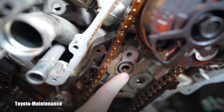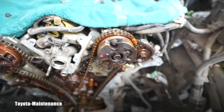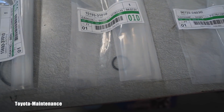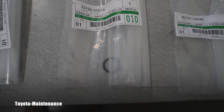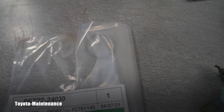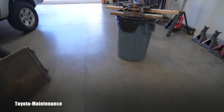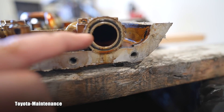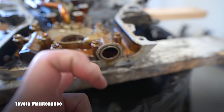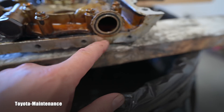Here is a very small o-ring — don't forget to replace this one. In the set I presented you, that's the small one. The bottom one is also for oil — it's larger and thinner. Here is the bottom one; don't ever forget about replacing it. This one is tricky — you need to kind of glue it in, put it in place, put FIPG around it, and obviously seal all the other areas.